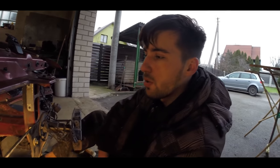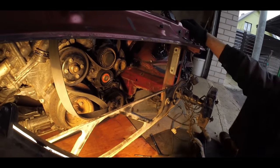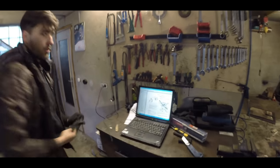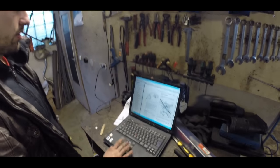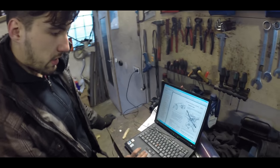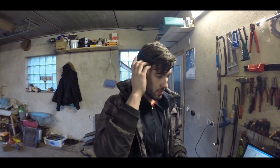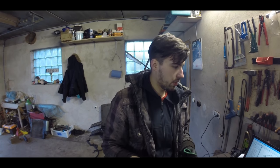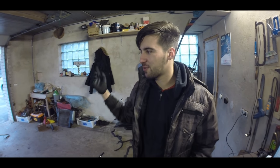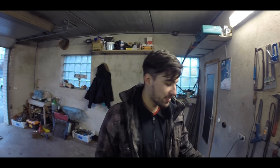There's one very important thing for these engines — tightening torques. You must have a manual for this. Download a BMW Bentley manual, which has all the information — from maintenance to wiring diagrams to tightening torque for every bolt in the car. The reason I'm stressing it is because I've already broken three places where you screw a nut — I've stripped three bolts. You have to be very careful because it's aluminium and it's really easy to make a mistake.